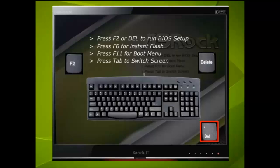It is important to remember that not all startup screens are the same, and in some cases some messages may not appear in this order or may not appear at all. The one thing we can be sure of is that a message will prompt us on how to enter the setup or the BIOS utility. If you missed which key it is, a simple trick is to shut down the computer, disconnect the keyboard, then when you switch the computer back on, in most cases a message will appear similar to "Keyboard error, press Del to enter setup." With the keyboard connected, you will need to start tapping the required key as soon as the message "Press Del to enter setup" appears.